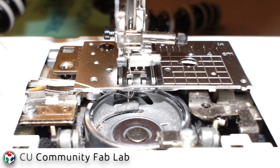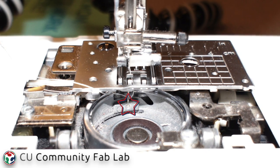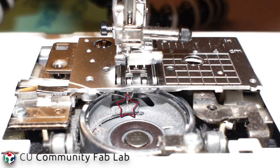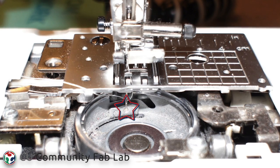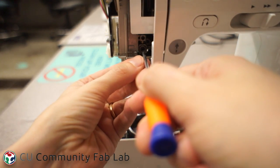It's really hard to see in the video, so here's a picture. It's a little white dot, and when the needle crosses that point at its lowest position, its point should look like it's right in front of that dot. Too high and it will not go low enough for the bobbin thread and needle thread to connect. If it's too low, it'll scrape the metal part that holds the bobbin carriage. To loosen the needle bar, you'll need a Torx screwdriver.